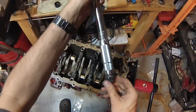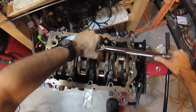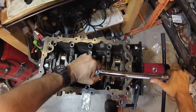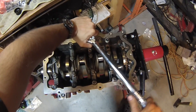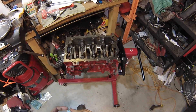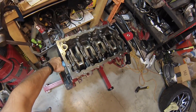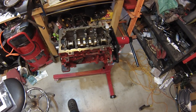You want to make sure there's nothing in the bolt hole. If there's fluid in there and you tighten down the bolt and it compresses it, you could get cracking. So we want to make sure it's nice and clean. We'll set our torque wrench to 44 foot pounds, and as always, you want to tighten from the inside out. Next we'll do the outer bolts, and the torque value for those is 26 foot pounds. It will take some time for this HondaBond to set up — probably a good idea not to run the motor for at least a couple hours, but it'll take about that long to finish putting it together and put it back in the car anyway.